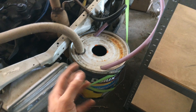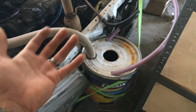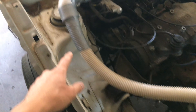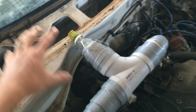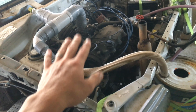So what that does is you get hot water inside there, where the petrol is then heated slowly as the engine gets hotter and as the coolant runs in there longer. The more hot you get that petrol, the more vapor it produces. And you're going to have more fuel available, because we're using the vapor, not the liquid — so the more you heat it up, the more fuel you have available. That vapor is sucked in through this pipe. I also had a valve on here, which would pretty much control my fresh air intake, so I have my fuel intake and my air intake and I adjust that valve to get that roughly right.